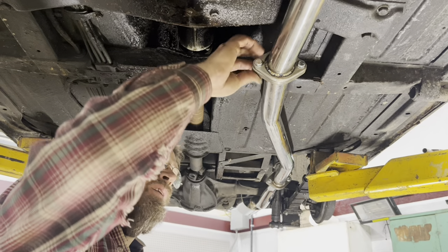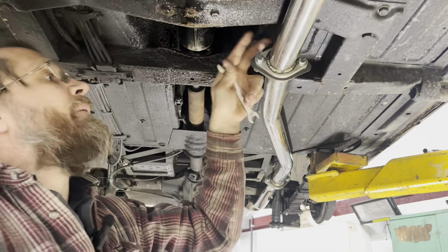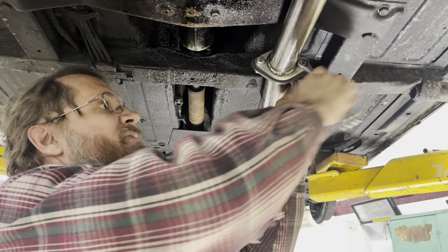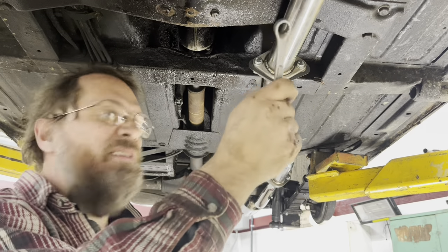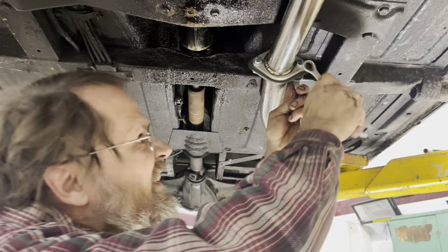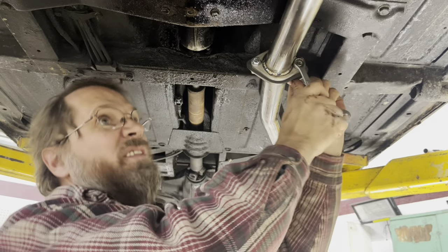Now I can go ahead and loosen these back up, put the gaskets in with the lock washers on, and actually tighten everything down. You'll notice as you're starting to put this together, it looks like there's a bit of a gap at the very top here, but that's actually not a problem. As you tighten it, that's the angle it wants to be at. That's why you don't completely tighten it up at the manifold yet — you get everything lined up and tightened down as you go, then go back and finish tightening at the manifold. If you tighten the manifold first, you can end up with it angled in a direction that doesn't work, and then you think the rest of the system is way off.